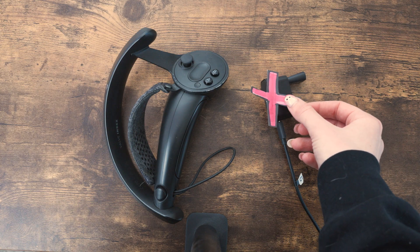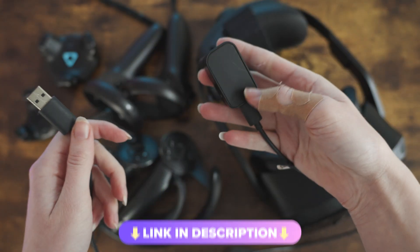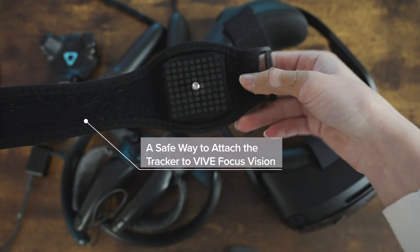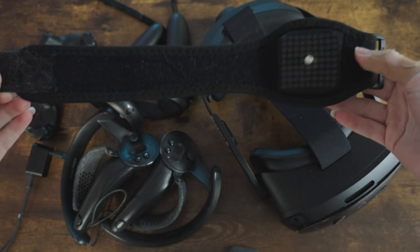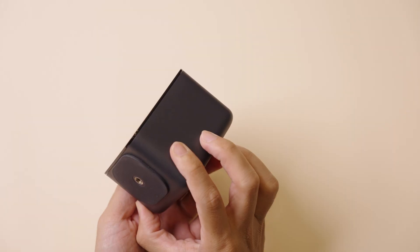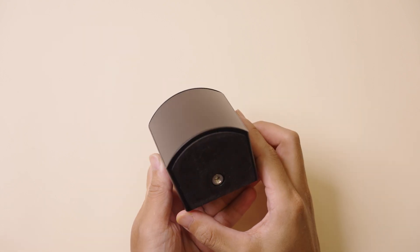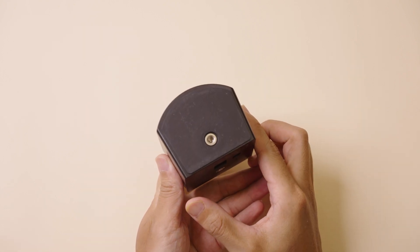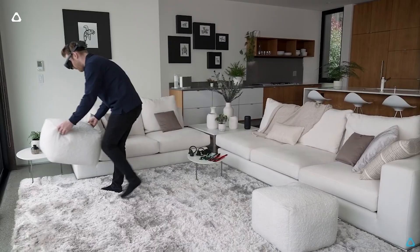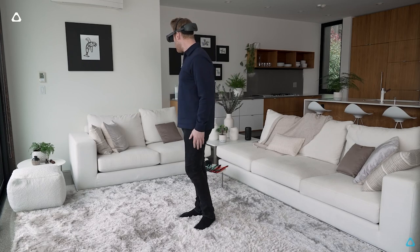We'll be talking about manual calibration and continuous calibration, and the difference between those two a little bit later. The Index Controllers do not come with dongles — you can check out the link in the description to buy singular dongles. You'll also need a tracker strap or a way of strapping your tracker to your headset. You can find 3D mounts online, but in a pinch a tracker strap will do. As for the base stations, you can either have two 1.0 or two 2.0 base stations for most basic VR setups. If you plan on using VR frequently or expanding your space in the future, the 2.0 base stations are a better long-term investment.